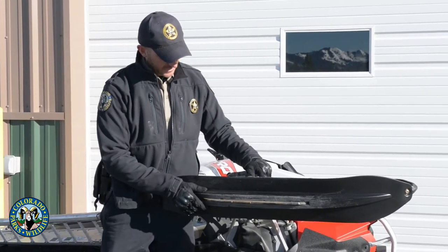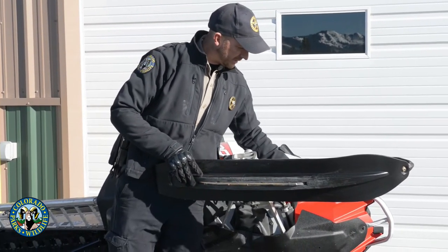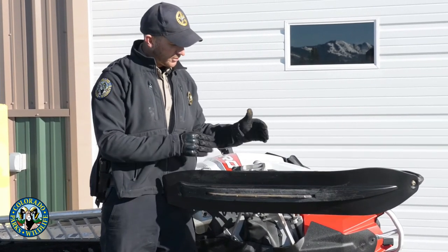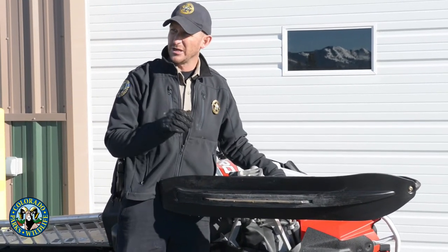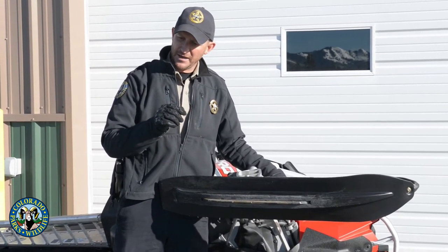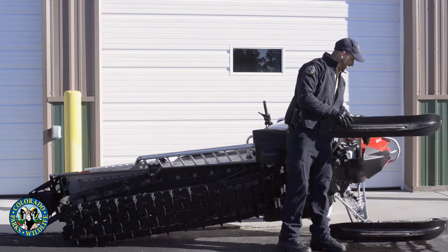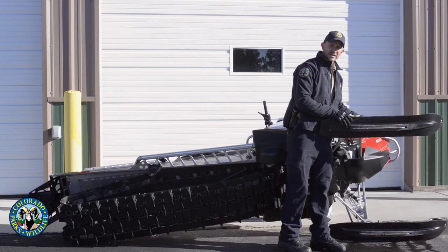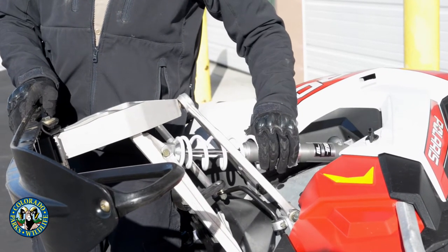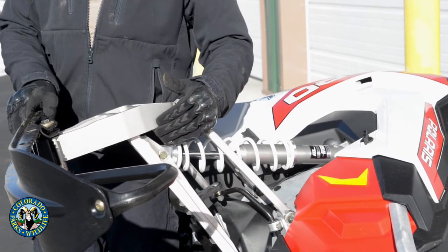Also when it's on its side, look down your machine and make sure the suspension is straight and your A-arms aren't tweaked. If they're painted it's easy to tell if they've had a small impact because the paint will start to crack — at that point your A-arm is toast and needs to be replaced because it'll fail on you eventually. Also make sure your shock is still centered within your A-arms, because that would tell you if one side is pushed in.